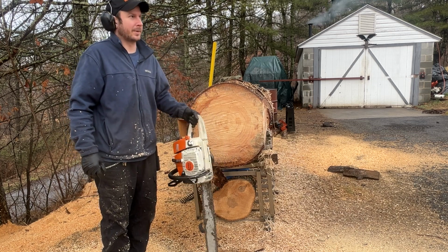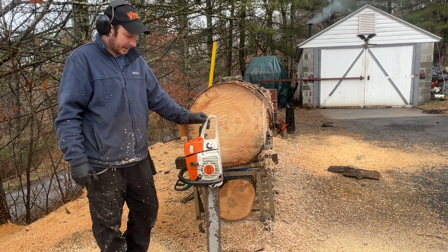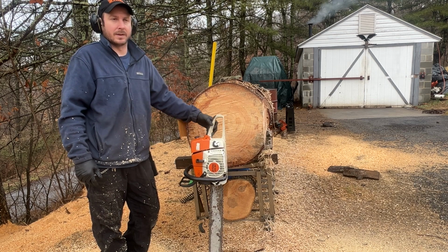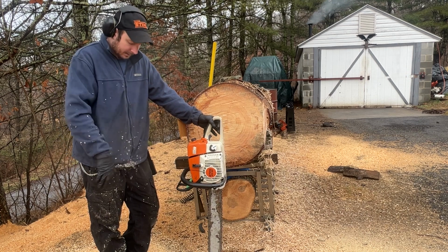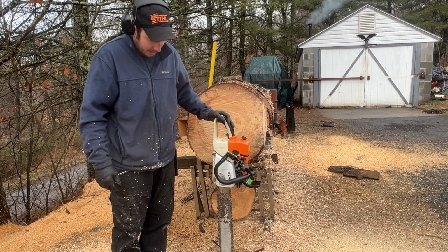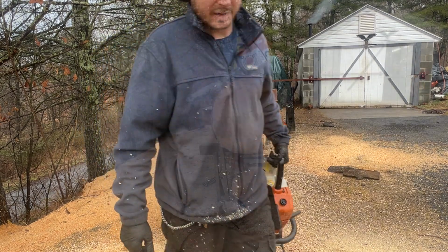Clean saw, but anyway, see if there were any improvements with that. But where we're going, we need that carb anyway. You can tell these things really respond well to a slight compression increase and some port timing. So get in here and get it ported, and get back out here and see if we made any improvements.